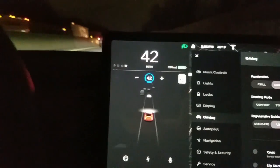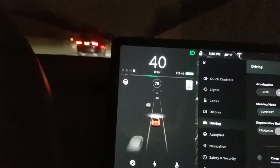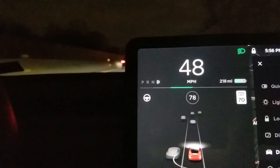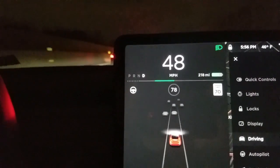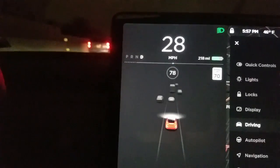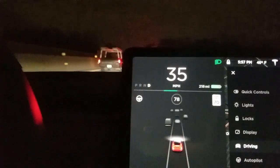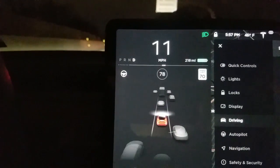So let me switch to low and pop out of autopilot, take off cruise, speed up and then let go. Notice it's full regen briefly, then I'm going to speed up and let go of the power pedal — and that's as far as it goes. So in low setting when I'm manually driving, your regen is only about an inch to the left. And then if you press the brake, you don't get any more regen than that inch to the left.